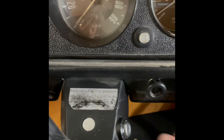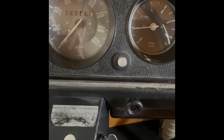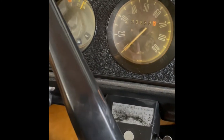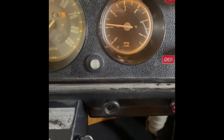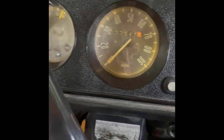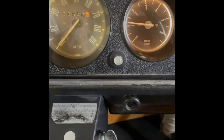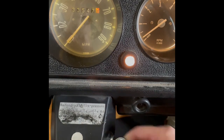Time to test it — moment of truth. And the illumination works too. If I dim it, there is a slight difference in color. A person could maybe put some kind of a resistor or rheostat in line with that tachometer illumination, but I think I'm going to leave it like that. It doesn't seem overly bright, especially since we put it in series with those other bulbs — I think that reduced some of the wattage headed toward the tachometer illumination. Thanks for watching and good luck.